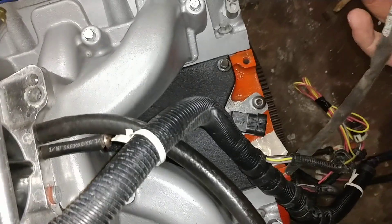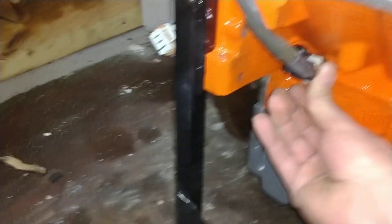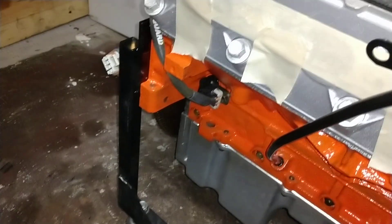Covered with high temperature shrink — pro heat guard. That's your crank sensor. Crank sensor on these engines is right here, kind of a tight fit right by the starter. There's your crank sensor. If you have a black sensor, you have an early Gen 3 motor through 2005-2006. If it's a gray sensor, it is a Gen 4 motor.